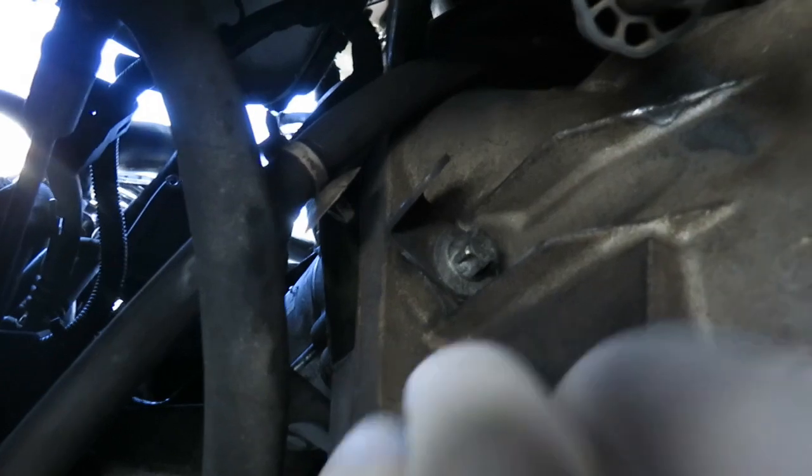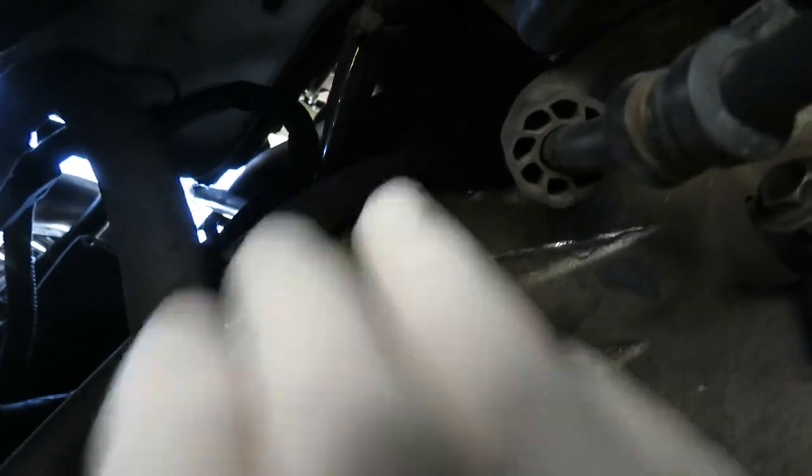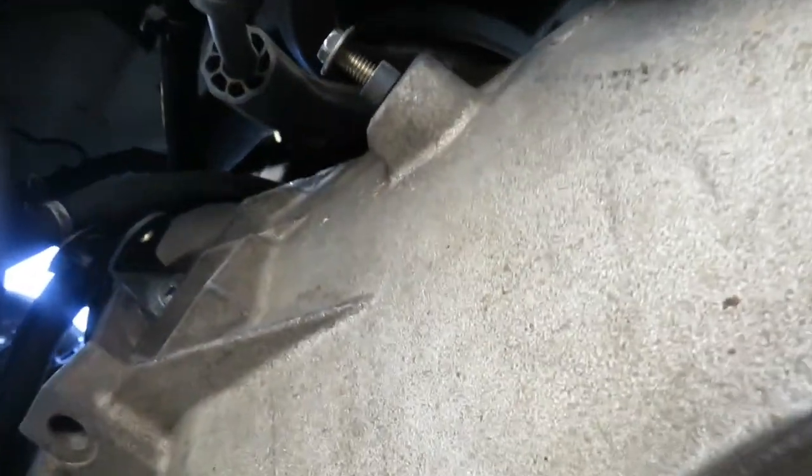We're underneath. We've got two bolts holding the starter motor in, where it meets your transmission. This is on a Mercedes Sprinter 208 CDI — I'm sure there are many Sprinters that are probably the same. You've got one bolt here and one just up here. I need to move the gear lever, the brace plate, and everything out of my way, and take off this bolt as well, just so I have some freedom to get into that other top bolt. Access is very limited.